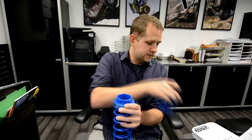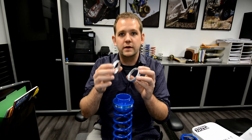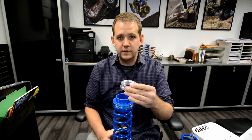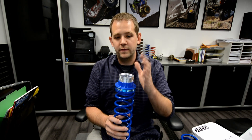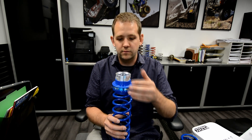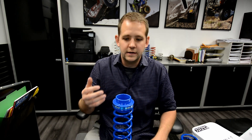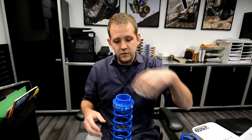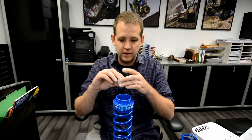Most dual rate coilovers should come with stop nuts, and a common question is what are these nuts for? They're threaded on the shock cylinder, and as the springs compress, the slider will eventually contact them — that stops the movement of the upper spring, transferring all of the energy and movement to the lower spring. That's how you get your dual rate setup. You have your primary rate, which is really a combination of your upper and lower springs working together. As soon as they engage the stop nuts, you take the upper spring out of the equation and you're just on your lower spring.